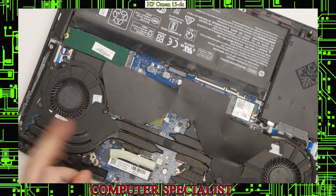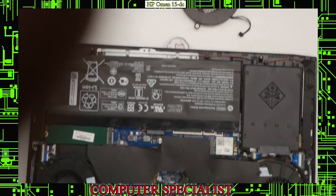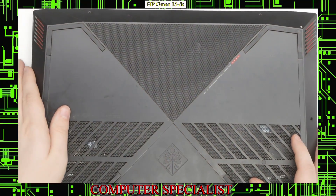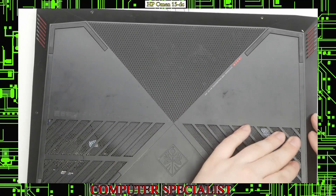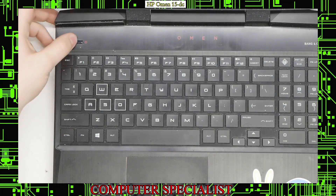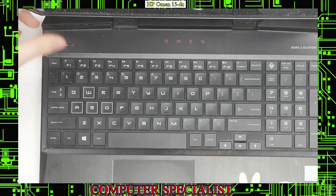Make sure we haven't forgotten anything — looking good. We have all our fan screws in. Now we can put the bottom cover back on, snap that back on, and before we put the bottom screws in we will just test it — run a benchmark and stress test just to make sure the thermal paste and the new fans are working correctly. Then we'll put the bottom screws in. That's pretty much it for how to replace the fans on the HP Omen 15-DC. If you have any questions, make sure to leave a comment, and feel free to subscribe for more videos.